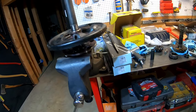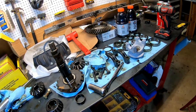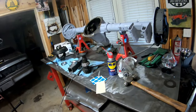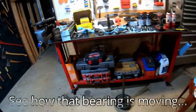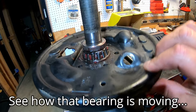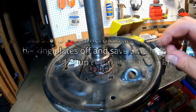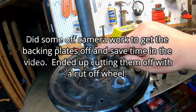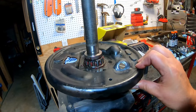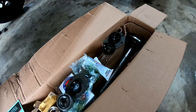Down in the basement, I've got both axle shafts out. We're also in the middle of a gear change on a Camaro build with a GM 10-bolt, so hopefully I don't mix up any parts. I need to get the backing plates off, which requires getting the bearing off. The bearing doesn't look like it's on there very well, but the collar is tight. I'll try an air hammer to get it off. I have all new parts, so I'm not overly worried about damage.